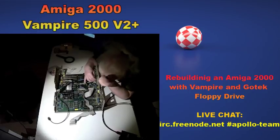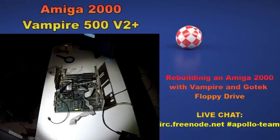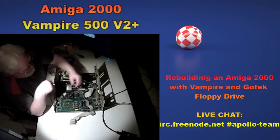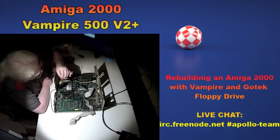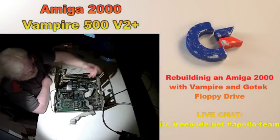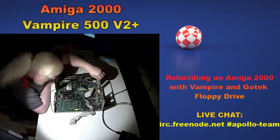So that is the HDMI port and the USB port that I created, installed. Now I just connected a Molex connector from an old fan onto the 5-volt rail right off the power supply. So it's just a standard Molex, and that just provides power. The USB doesn't do anything other than that. That's strictly for power purposes. So, let's see here. Yep, there should be. So, moving on.